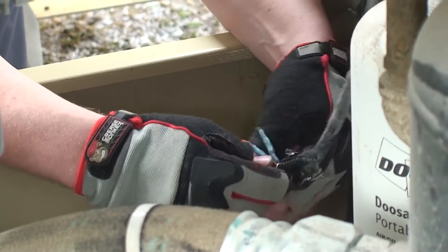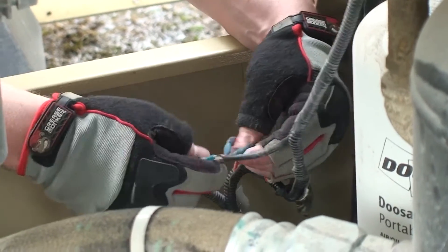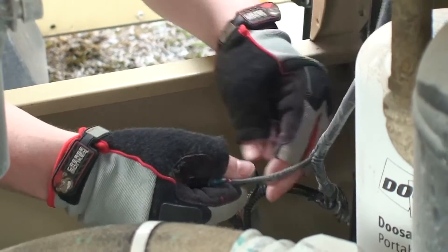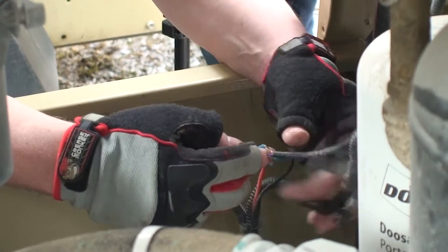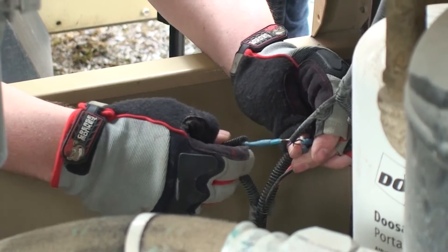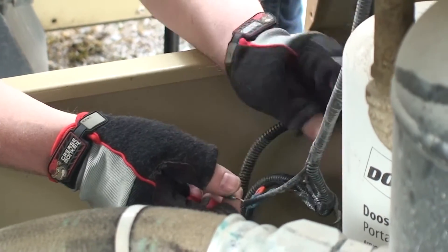The previous 2G device also used a 3-wire harness with the same color pinout as the MC3 3-wire harness. So naturally, we will want to connect the red with the red, black with the black, and the white with the white. When tapping into a previous installer's wiring, you will need to ensure that their connections are properly connected.